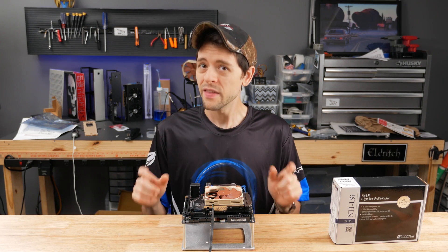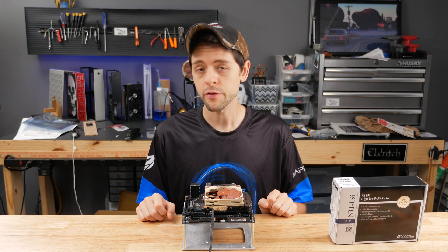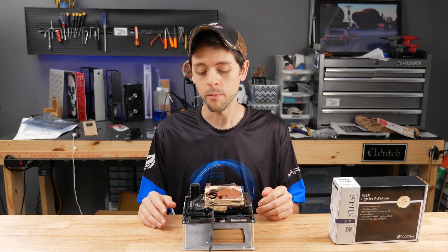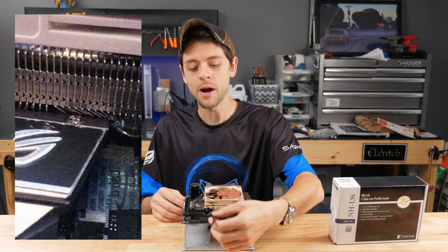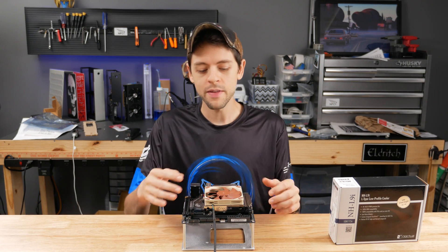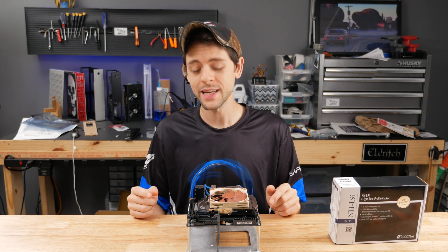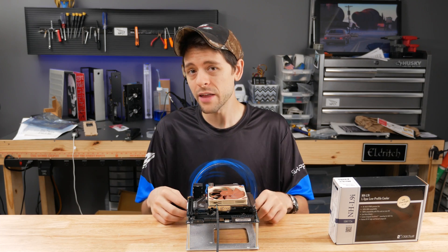In some Mini ITX motherboards, they can get quite crowded, and this means the Noctua cooler can only be installed one direction without interfering with some of the gizmos and gadgets on these motherboards. The Asus Strix Z270i is a phenomenally popular motherboard for the S4 Mini, and many customers end up installing this incorrectly by accident. With the proper installation, you'll see this cable down here pointing towards the RAM slots, and this allows the cooler to not interfere with the heatsink for the SSD module. There is actually only one orientation that will work with the Z270i Strix from Asus and possibly other Mini ITX motherboards.